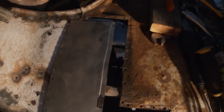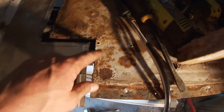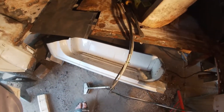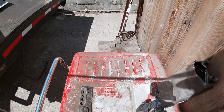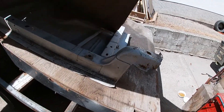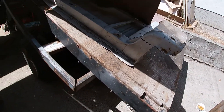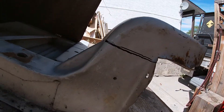We're going to rust inhibit all of this once it's welded up anyway — give it a good grind down, good paint job, so it should be just fine. I'll have to fit the next one in, get all the plug welds plugged up and weld it up. Then I can finally start putting the footwell back in. My little blown-up welder — got a new one; I'll show you guys the new welder. Days are all kind of blending together, but I still have to cut this off.